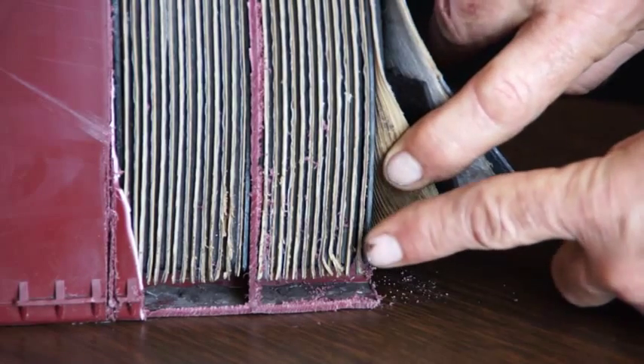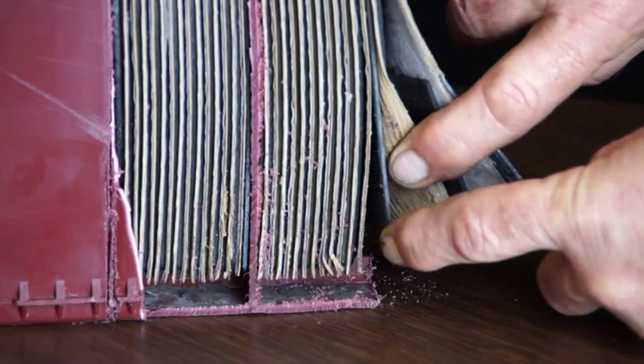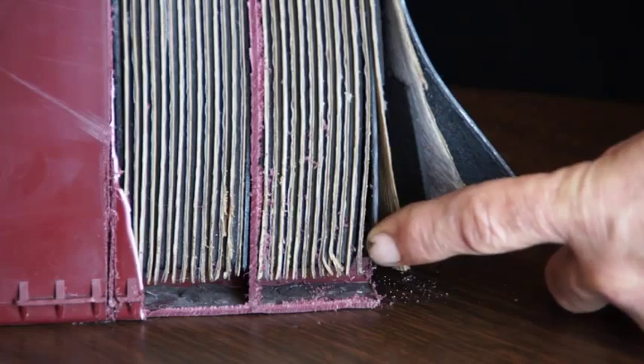What makes the quality? The grid material, the lead alloy, the lead that goes into it, the strength of the grid, and its resistance — so we could get a battery that we only get two or three useful seasons from, or we could get a battery that's guaranteed for seven or ten years, which you pay, obviously, a premium price up front.